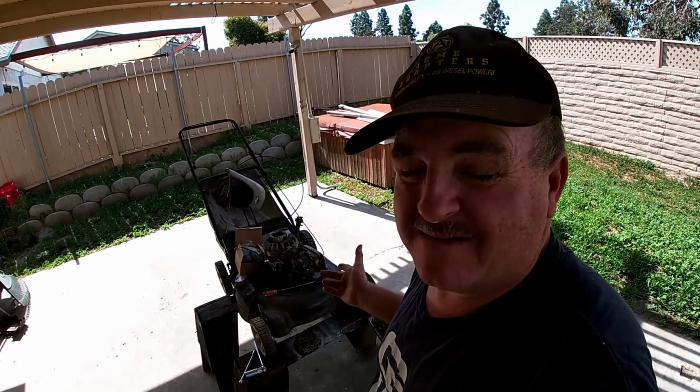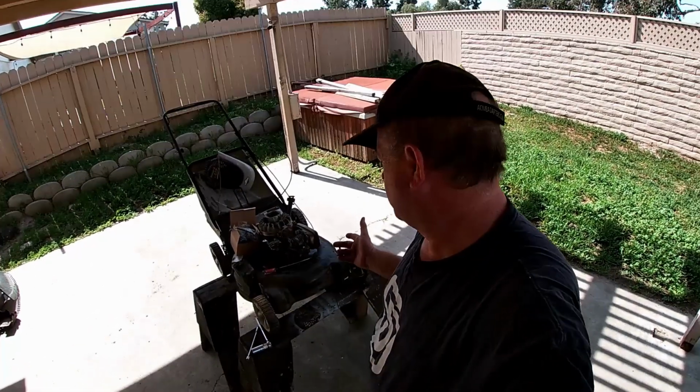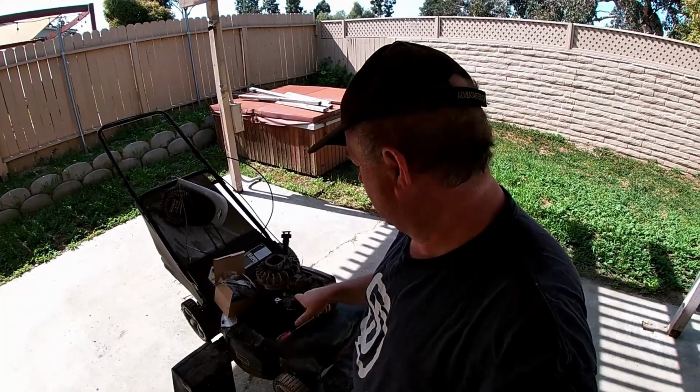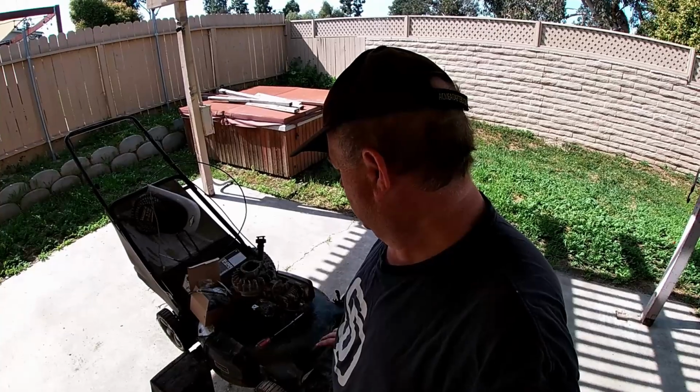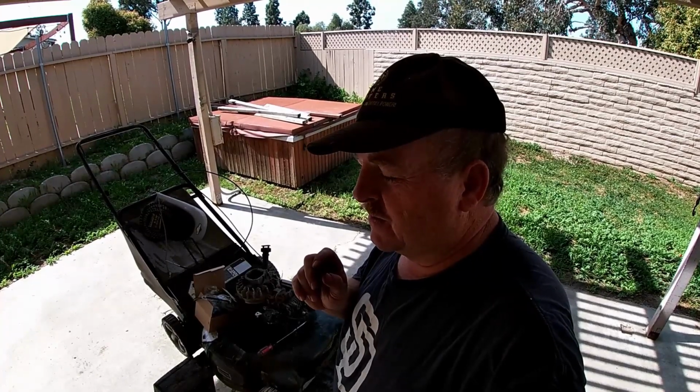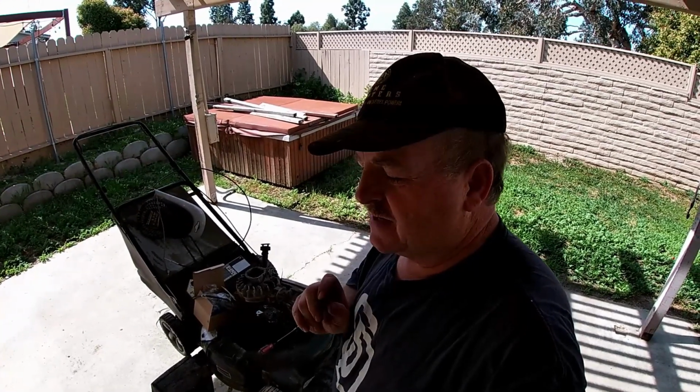Gonna have to get some parts. It takes some time to do it. To make these flanges is not easy. It's gonna take some time in the garage. And this has got a special flange that has an O-ring seal on it. So I don't think that'll be that difficult. I just gotta make sure that I measure correctly and get that opening where the O-ring goes perfect, so that when I tighten it up, it'll seal really nice on there.